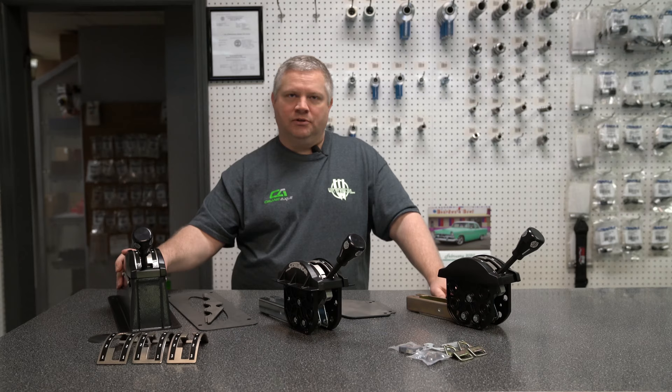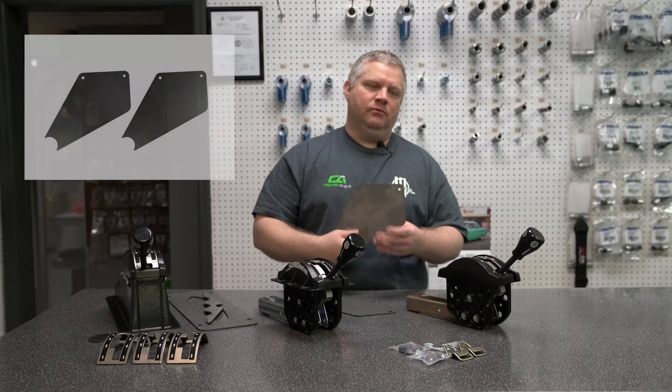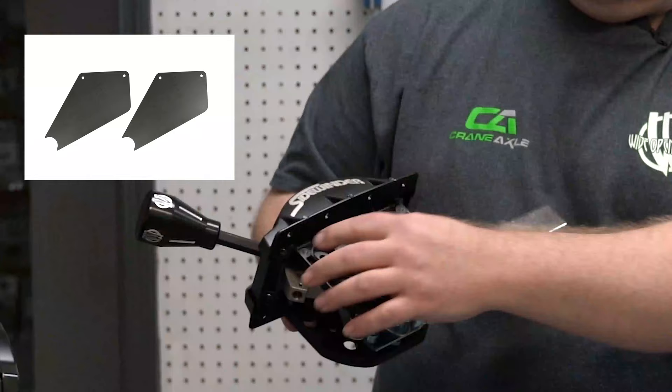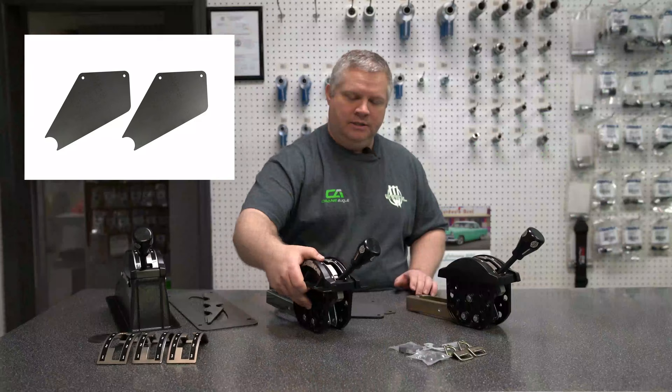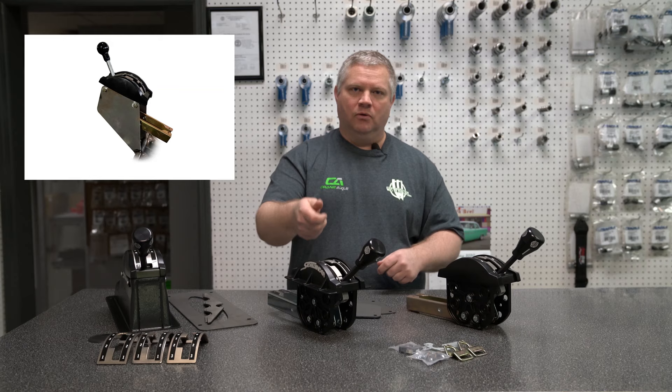The next one is the flush mount. It is made to be mounted with the four vertical bolts per side. We do have a mount that fits it — we consider this our no console mount, but it will physically fit this shifter. It bolts in at the two bolts where the shifter housing bolts in right here — two quarter-twenty bolts. It bolts in at one position, coped for tube, and allows you to pivot it, raise it, lower it, trim it, whatever you need to do.